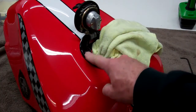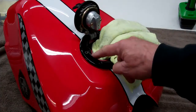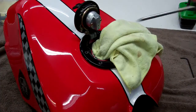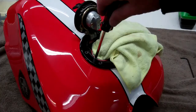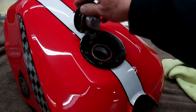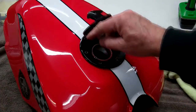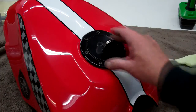The outside screws are just tight but not too tight. Then what we want to do is go ahead and put the small screw back in here with the rag in the tank, and go ahead and snug that one up a little bit. Then we'll go ahead and take the rag out, close that back up and tighten these up. After you get finished, just check that again, snug that, and then that gas cap is ready to go.